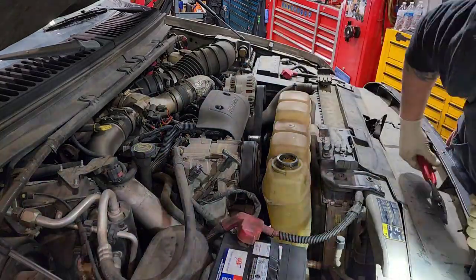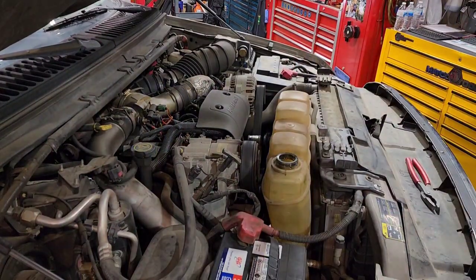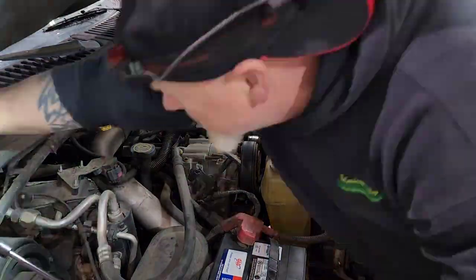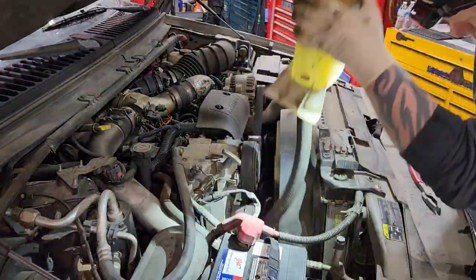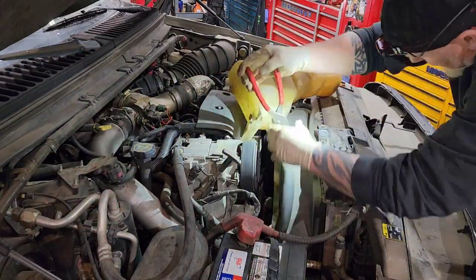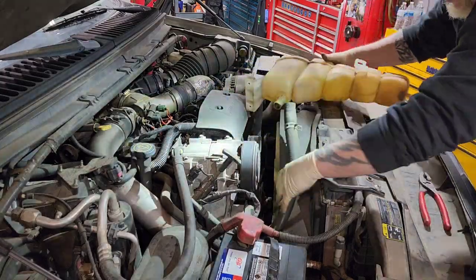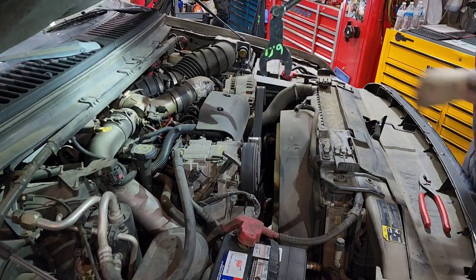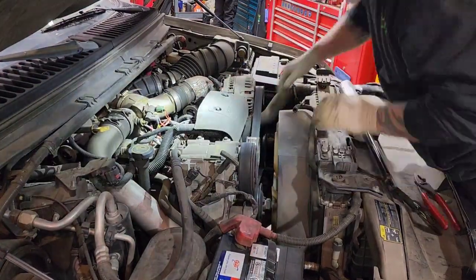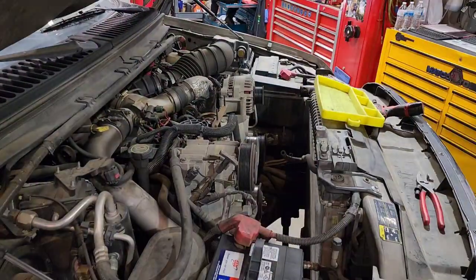When I do injector cups, my goal is that when I get done I have zero fuel in the cooling system. It's very common to get done with this and have a little bit of fuel that ends up floating back in the bottle. If the bottle is really bad I'll replace it when I do the job; if it's not extremely bad I'll clean it the best I can, do the job, flush the cooling system, and then in 5,000 miles when it comes back for an oil change I'll replace the bottle — that'll capture any fuel that's left over.